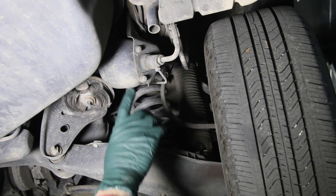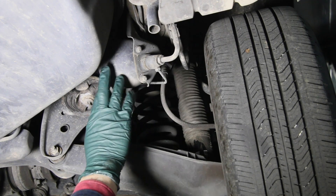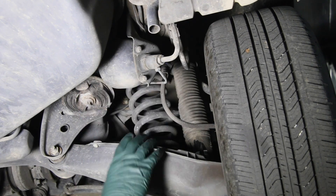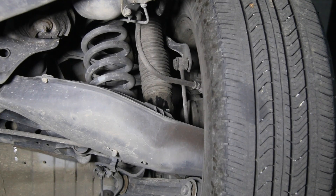If you've had a look at any of the older cars with SLS, you'll notice right away that the accumulator is located right here — very easy access, very easy to change. On the W210 chassis, I'm looking around checking fittings for any signs of leaks, and then I'm looking up at the hydraulic strut, looking for any wetness particularly along the bottom.